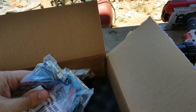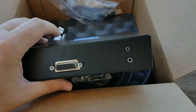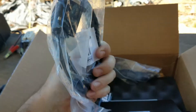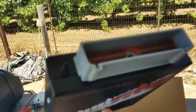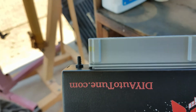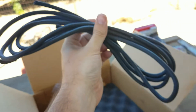This plugs into the back of the computer right here at this little port on the top. This will connect, and then you connect this part here to this and you're good to go — plug that into your laptop. Now this one has a boost reference. That little nipple right there will connect to your intake manifold. They send you a bunch of hose, so you got plenty of hose to go from your intake, or if you really want to, you can go from a port using a little adapter.